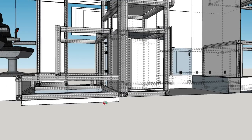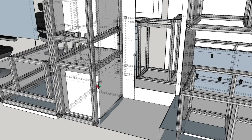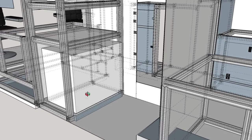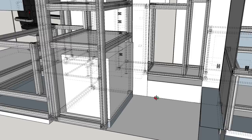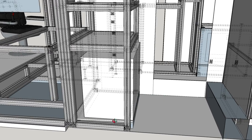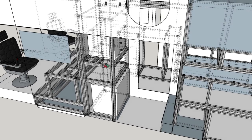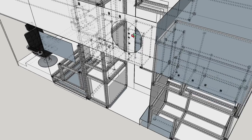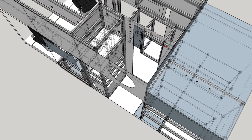The reason this area is slightly lower is because the tank will sit against the floor with very thin insulation underneath, whereas the rest of the van is up on 25mm insulation and 18mm ply. There's the cassette loo idea that I'm sticking with — it's going to be on runners, so there'll be a handle on the front, you pull it out into the shower room when you want to use it, then slide it back in, with heavy duty drawer runners along the sides to support it. That's going to be the space for the bed, and also daytime storage for bedding possibly. There's the porthole, and there'll be more storage at the back from the shower room for bits and bobs.